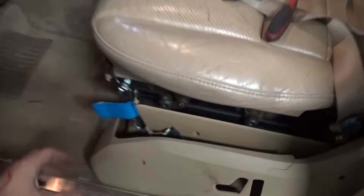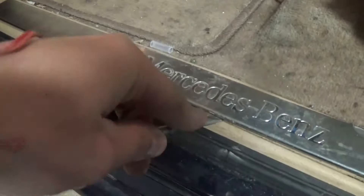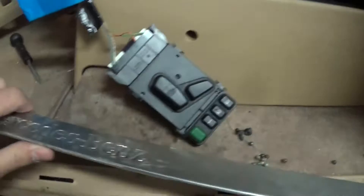You have a plastic cover for the seat with two screws — use a Phillips screwdriver, one here and one there, to remove it and take it out of the way. Next, use a flathead screwdriver to get underneath the plastic piece, pull it out starting from the front, because that's the one that sits in a groove.